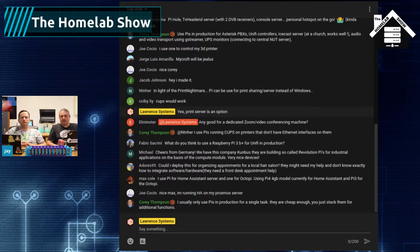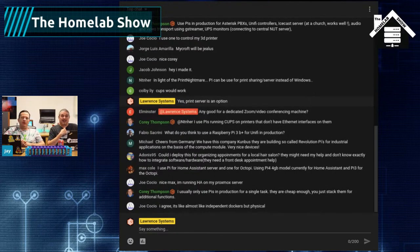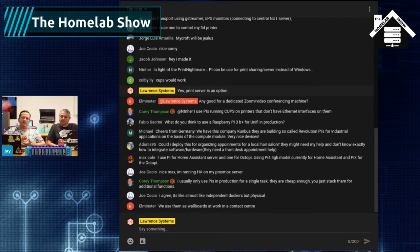You're using it because you're learning Nextcloud, learning how to set it up and configure it. User limitations are still going to be there — you're limited by the processor even if you have 8 GB of RAM. Another thing you can run on Raspberry Pi is OpenMediaVault. When you get into NAS territory, feasibility depends on what's pulling from the NAS and the bandwidth. You can absolutely add an SSD — even an M.2 SSD. You're probably not going to get the full performance of that SSD but it'll be very good compared to the SD card.